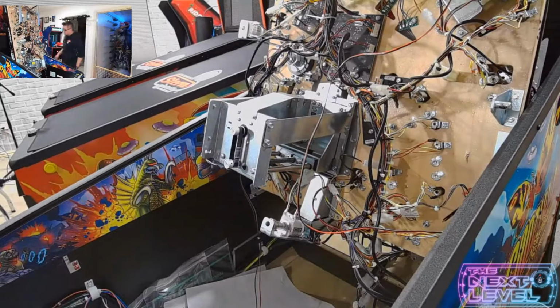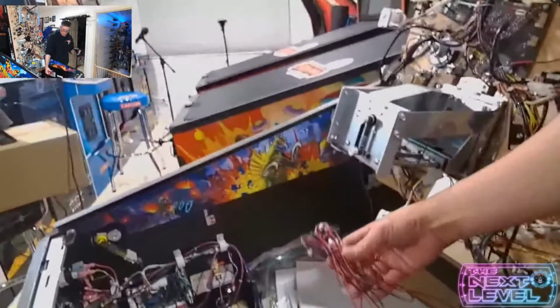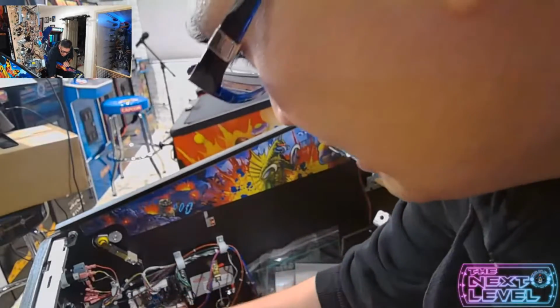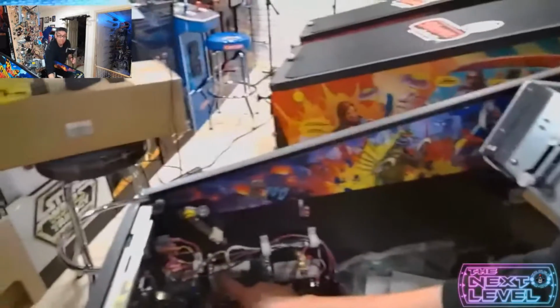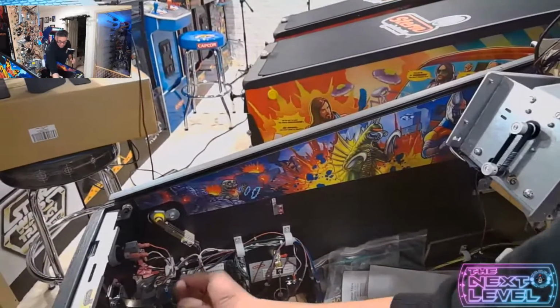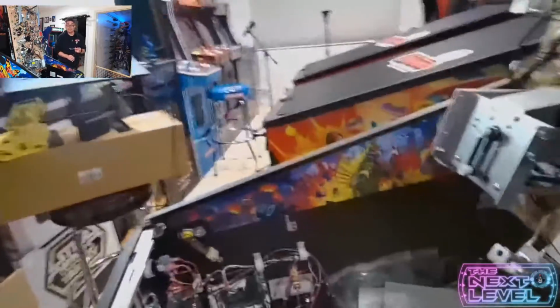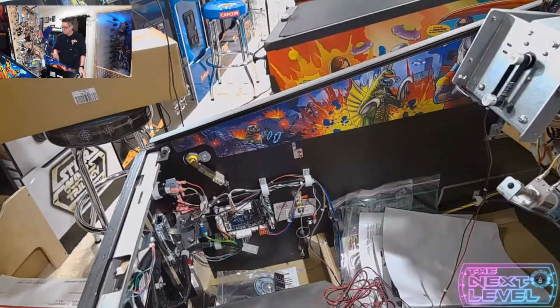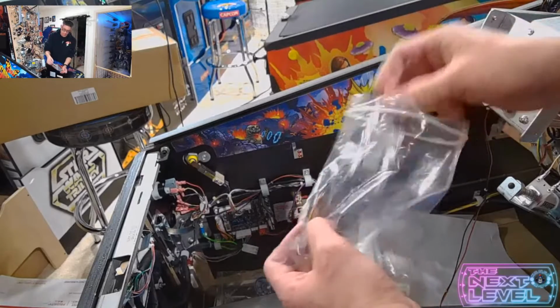Okay, all right, so the GI sensing bulb, we got to do the GI sensing bulb here. That's one thing we got to do. And then we also have to wire the power all the way through to this board over here. Normally, if this is the only thing that you're doing, you need an extra CN11 board right here. But this little CN11 connector is already being utilized by my Tokyo Neon sign mod. So there are no more empty spots here. This is why we're going to be installing a splitter to be able to have extra mods in here. So if you're going to have both the Tokyo Neon Sign mod and any of the future mods, you are going to need to install what's called the Splitter Plus, which will give us a lot more power slots to actually power these mods.